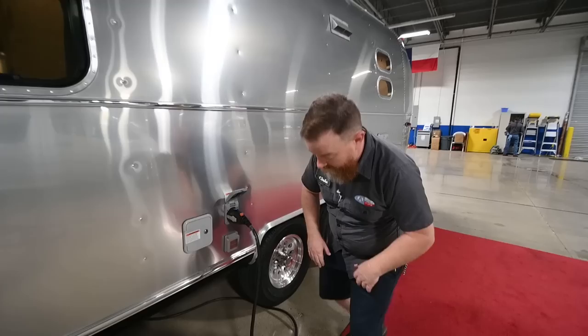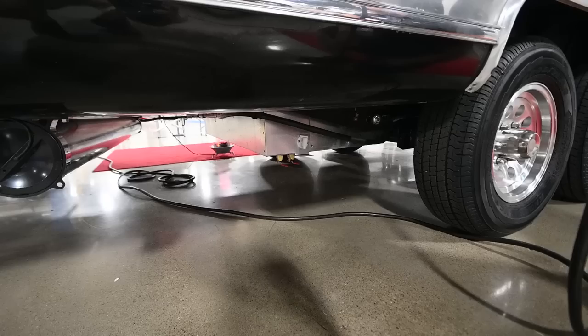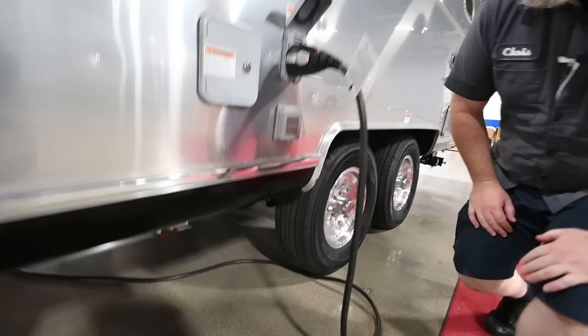The drain for the fresh tank is below. You'll see a little white petcock on the side of a silver case — rotate the flag at the top toward the rear of the trailer and it will slowly drain out. You'll also notice two brass valves with red handles down there; those are the low-point drains, and you'll open those when you're winterizing.